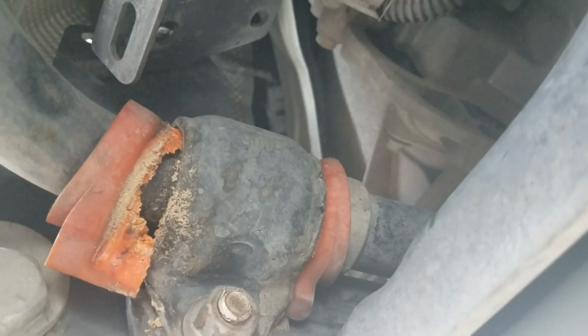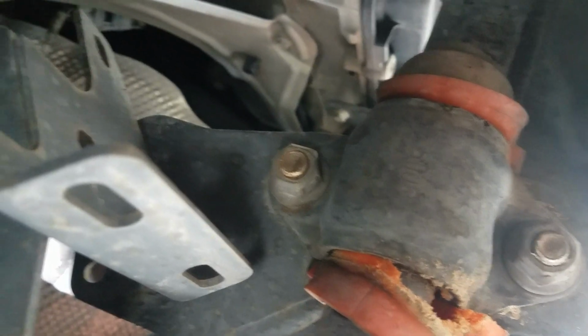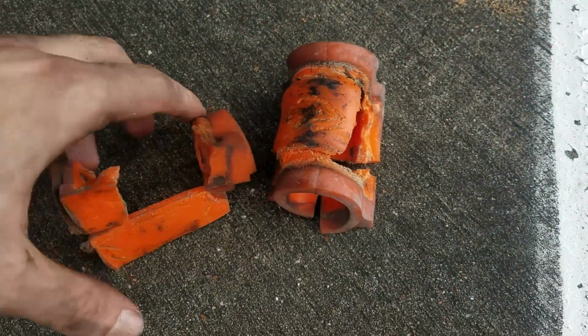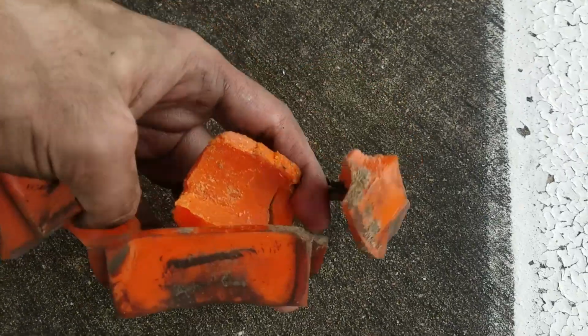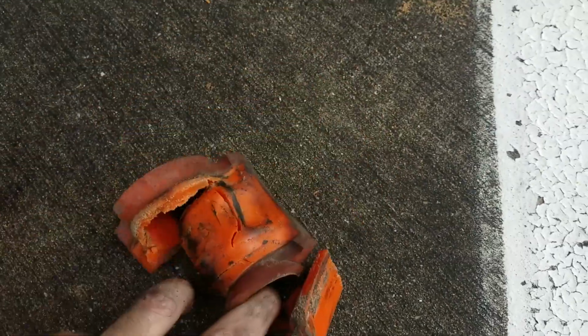The passenger side is a walk in the park compared to the driver's side since you can easily access the top and the bottom nut. The relatively quick wear on the orange bushing is why I'll probably use just the stock black bushings next time.